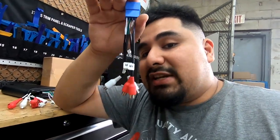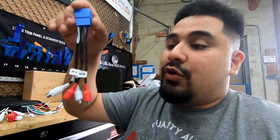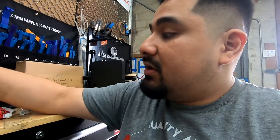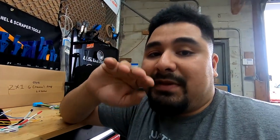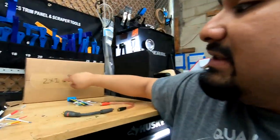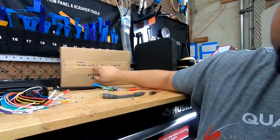So you only have 4 channels of audio out, but you need to amplify 6. The factory amplifier does this. Your aftermarket amplifier is gonna need to do this. Our JBL amp can take care of it, no problem. Remember, in our 4-channel amp, they were bridged, so we were only dealing with 4 channels of output. But if you're grabbing the DS18 amp or the Kicker KMA 600.6 amp, they're going to take 6 RCA ins, but you only have 4 to give. So you're like, what the hell do I do?